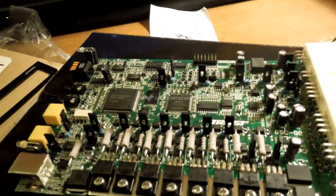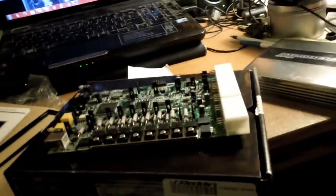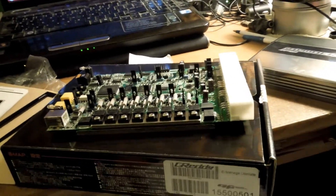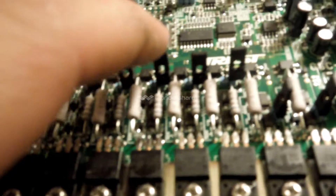All right guys, it's December 11, 2014. Right now I'm doing some configuration with the circuitry board with the E-Manage. It's not plug-and-play out of the box. You do have to change these jumpers around from pin 1-2 to 2-3, depending on your configuration.